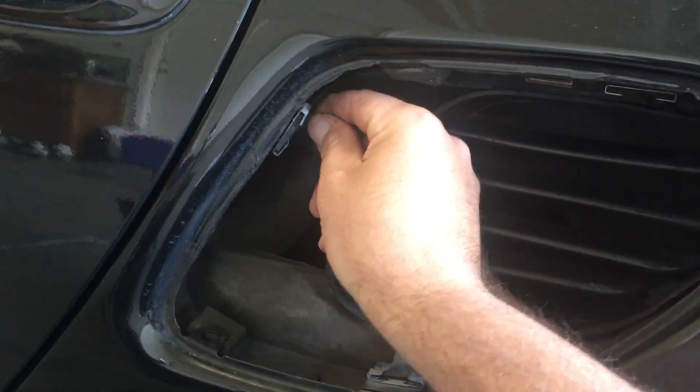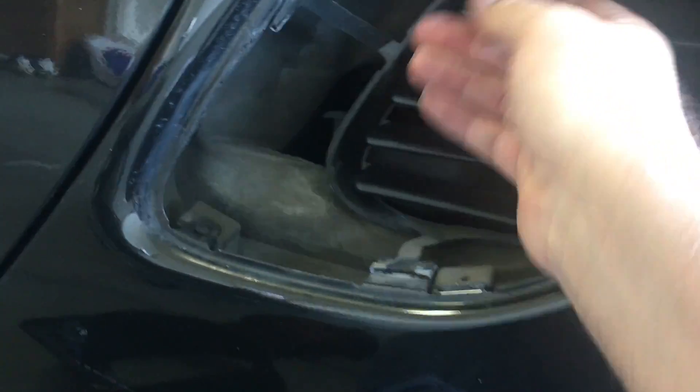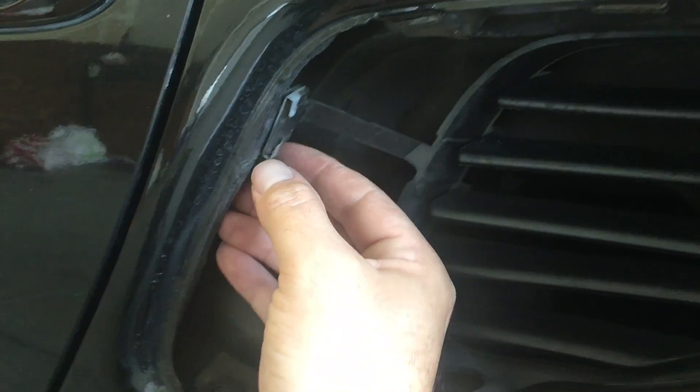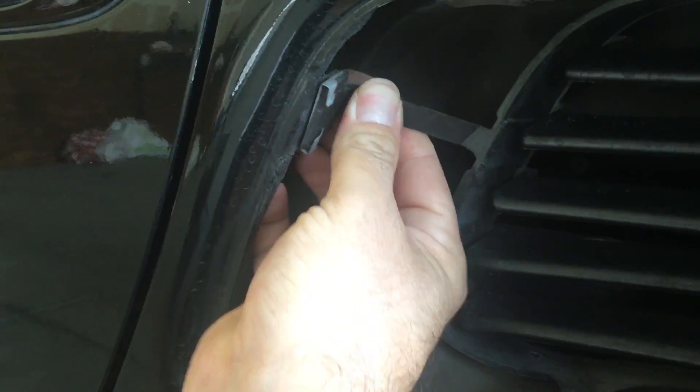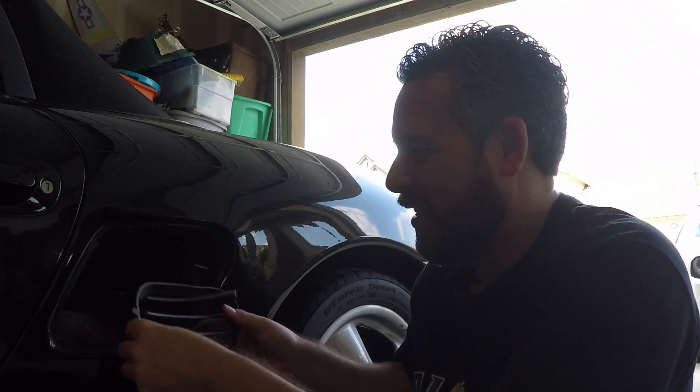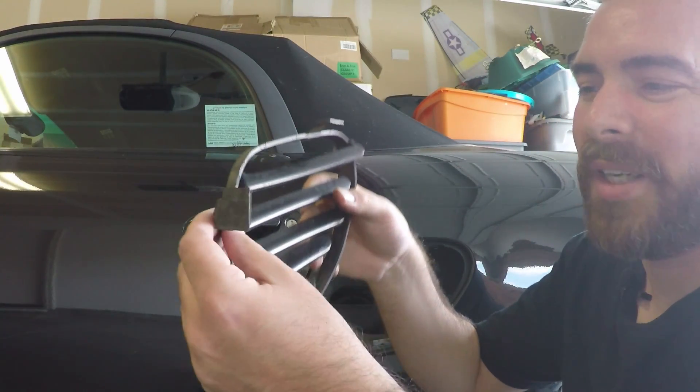Now from there you'll see that there are these little pieces held in and you want to be careful when you remove the inner cover because it could easily break. It's that easy to break — I snapped this off. Fortunately, this is part of Project Boxster R, we're going to be putting a mesh screen on here and changing the look anyway. This is plastic so it gets brittle easily and it looks like this one was glued already, so someone else has done the same thing.